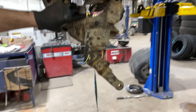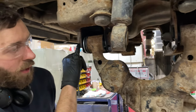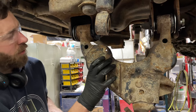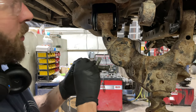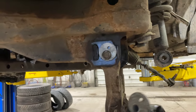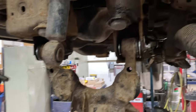There we go. I am working on getting some tools set up — different sizes of adapters and such — so I don't have to make it so sketchy. Okay, pretty much maxed out there. That looks good. This press needs service, as you can tell. So we've got our arms all ready to go back in, bushings pressed in, and I just cleaned up the threads on these nuts — I was able to save the nuts and all the bolts, but I did buy new ones because they were super tight. The sleeves and nuts and bolts all have to go in a certain way: long ones in the front, short ones in the back. The sleeve with the washer goes in from the front — washer side on the front — and for the back they go in the other way. Then the nut slides on the end and you put your bolt through from front and back.